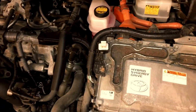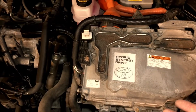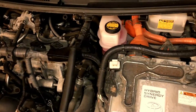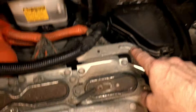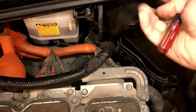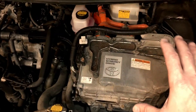The reason for AC is that the motor generators in the gearbox are high voltage AC synchronous permanent magnet motor generators — they can only utilize AC and they can only provide AC. So for charging purposes, if they're going to provide AC back to the battery, we're going to have to rectify that AC in order to charge the battery — whether it be the high voltage battery or through a separate connector at the back here that provides 12-volt DC to the auxiliary battery.